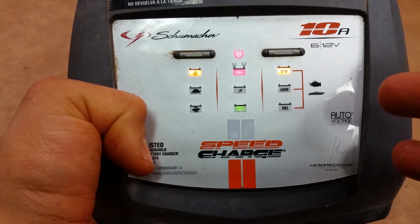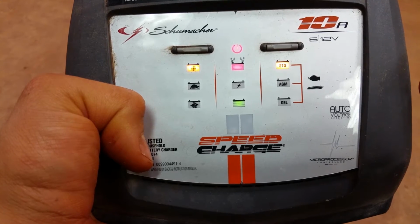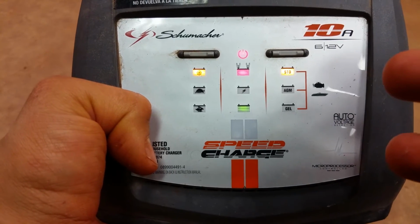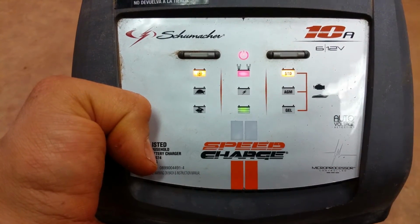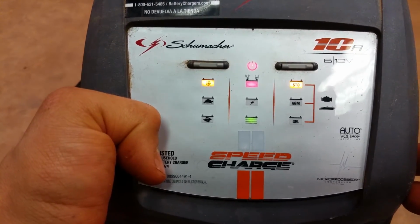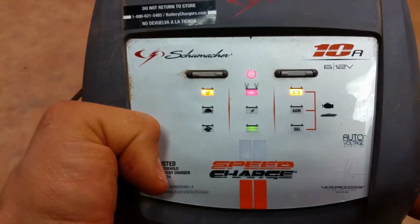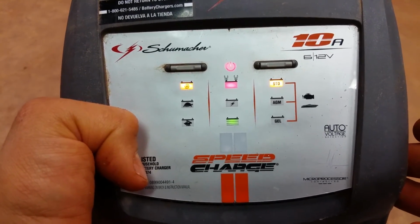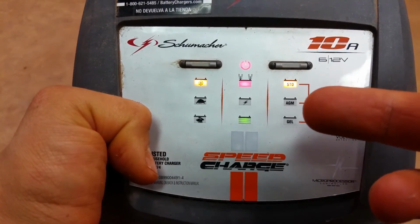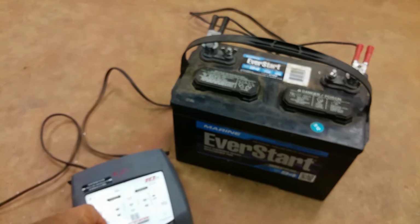They have basically like fiberglass, and the electrolyte gets soaked into the fiberglass, and once it's there, it's there permanently. It doesn't come out, it doesn't evaporate and stuff. It's soaked in it permanently. So that's what type those are. And gel, that's completely different. I mean, you're not going to run into a gel battery for a boat probably. But typically, a standard battery, a traditional wet cell battery, is what you have for an outboard or a truck or any of that stuff, unless you're spending a lot of money. And if you're spending a lot of money on boat batteries, you probably already have a pretty advanced charging system set up in your boat.